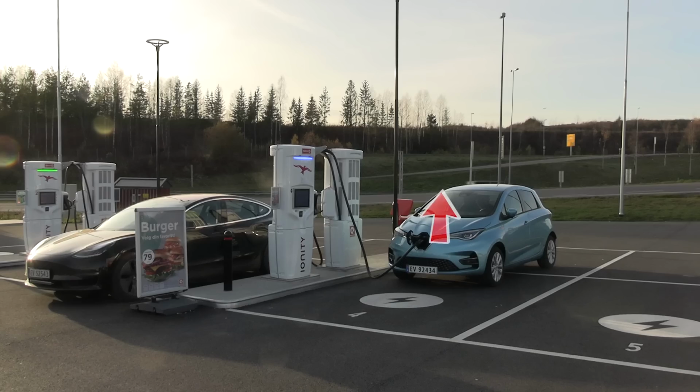because we need to know how hot or cold the battery is. I've seen in my Model 3 that one is more sophisticated. Once I start driving, leftover heat from the motors, mostly the rear motor, is transferred via a liquid loop to the battery to heat up the battery pack. But as far as I know, Zoe does not have a liquid system. It only has an air-cooled system. There's only one motor in the front. When we are driving, it's heating up, and I guess the heat from that just goes somewhere, maybe through the hood, and is lost forever.